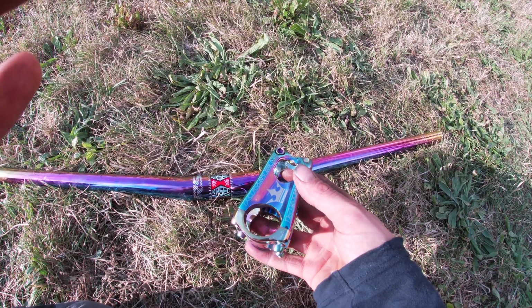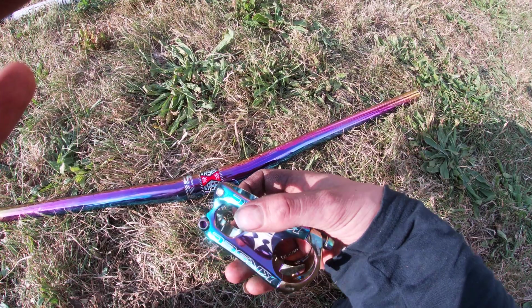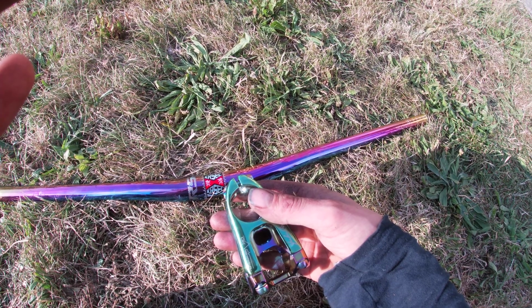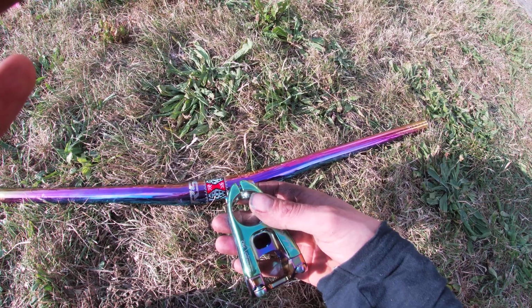You're only supposed to go about 6 to 7 Newton meters on stuff like this, and that was really giving it. That was over 40 Newton meters. It was what you put the crank bolts through, how tight you do the crank bolts in most cases, and that's just way too much. And even then, it still moved.